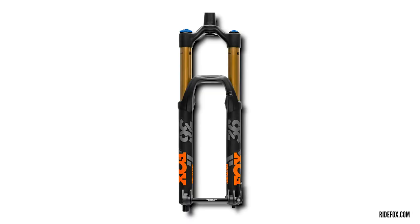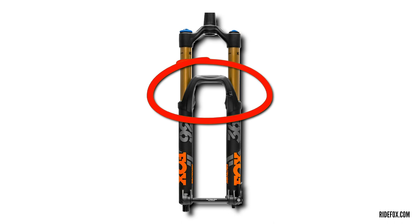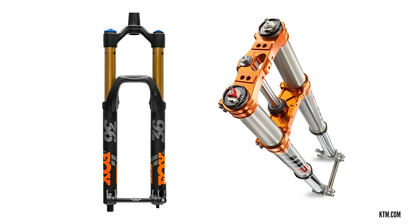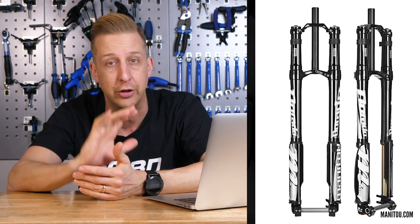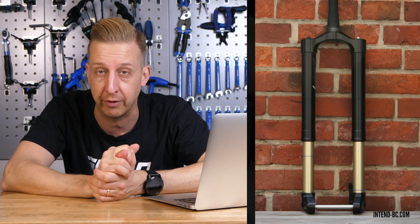Let's look at the suspension fork. The suspension fork really relies on the axle as part of the structure. You've got the brace at the top, and technically, if you look at the mountain bike suspension fork compared to a motorbike fork, we're actually inverted. The motorbike design has twin crowns with the bigger part of the fork at the top, the smaller part at the bottom, clamped together. Because of the size of the motorbike fork and the materials, they come out as clamps industrially sized to avoid flex. It's really important to have that through axle up front.